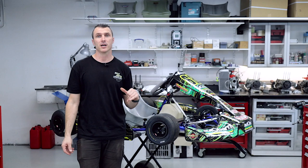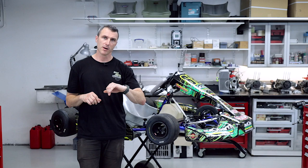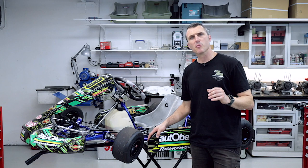On the Dent master cylinder it's more like a car brake system, where you fill the reservoir up, apply pressure to the pedal, crack the nipples, let the air out, close the nipple off, and then let the pedal off — rinse and repeat. So let's get to it. Our customer brought this kart in for its end-of-year service.